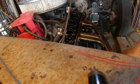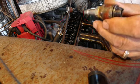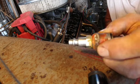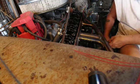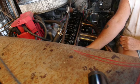That plug looks pretty good. Now I'll put in the air chuck that I made to go in the cylinder so that I can put air in there and the air should hold the valves closed.